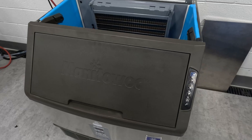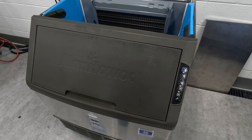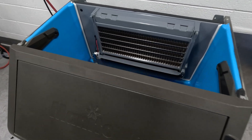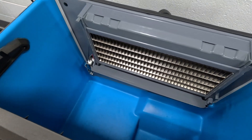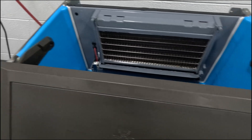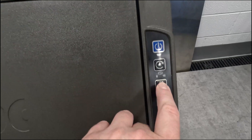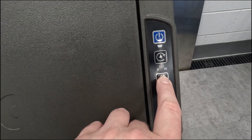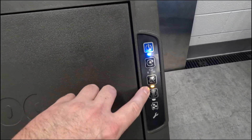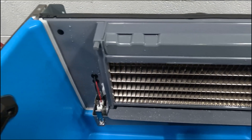An in-depth step-by-step guide to cleaning this machine can be found in your installation, operation, and maintenance manual, as well as your technician's handbook. We're not going to go very in-depth on fully cleaning this machine today — we're more just here to talk about the clogged drain fault. Let's start with putting this machine into a cleaning cycle. Make sure it's not in ice making mode, press and hold the clean button for a few seconds and release. The blue light will come on, the clean light will go on solid, and the first thing the machine is going to do is drain all of its water out.